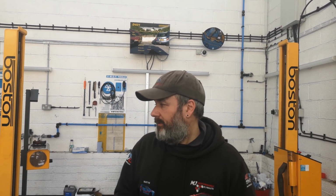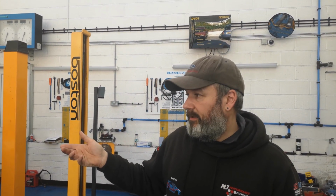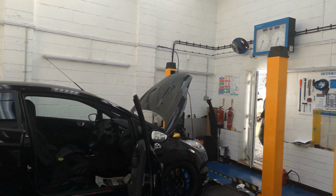He said to me, do a little example: dip your finger in the water and hold it up in the air, then dip your finger in the meth and hold it up in the air, and feel how cold that meth is on your finger. That's what's doing it. As well as that, Bruce explained there are a few added benefits to the engine in terms of running meth. It will clean through it, won't it? Yeah, and that's an added benefit for Monty's, because it's only done 1,200 miles, so the engine's still fresh and clean. A bit different on the Little Beast.